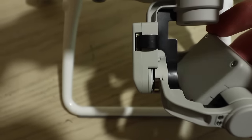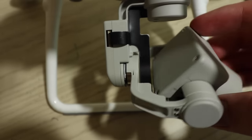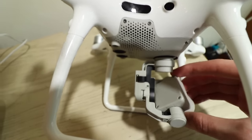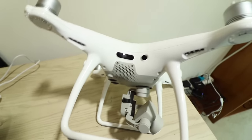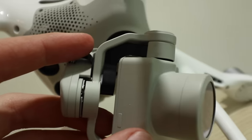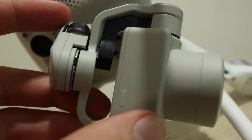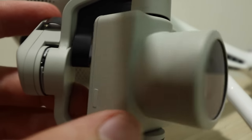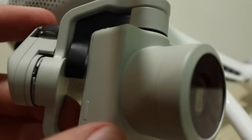When I move it up and down I can feel it hitting on something, and that's what's causing the overload. When I was panning down it just got stuck there and I was not able to break free. It's not a huge obstruction so it was sometimes able to adjust itself, but if it gets caught in the right spot it's not going to be able to move up and down at all. Here's an even better view — you can see how it's getting caught on this ribbon. It's less than a millimeter and it's just getting caught and stuck.